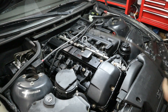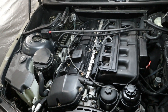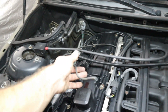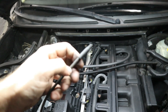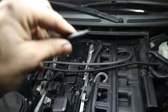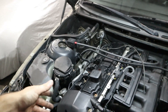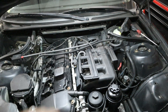I'll be honest — I actually broke this earlier when I was checking for a vacuum source before we started the video. But as I unclipped the vacuum line from the brackets on the side of the motor, it literally just came completely loose and out from the back of the motor. The vacuum line on both ends was dry enough to just start breaking apart naturally. So we're going to have to find the rest of the vacuum source, which I believe goes to a solenoid that controls the valve to be open or closed depending on if the car's doing its startup routine.